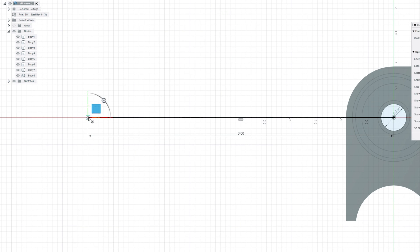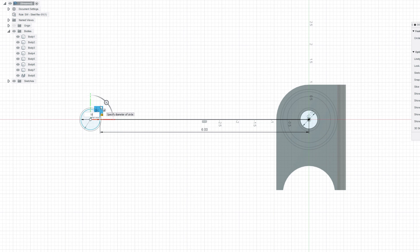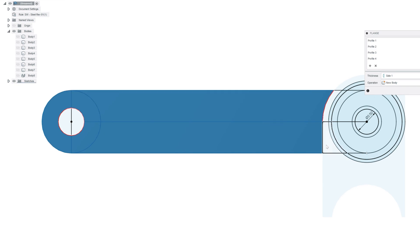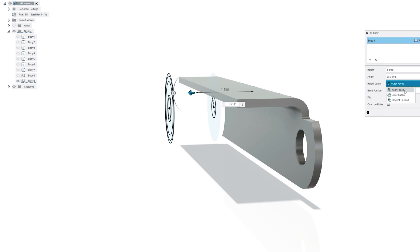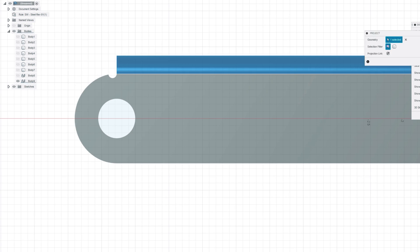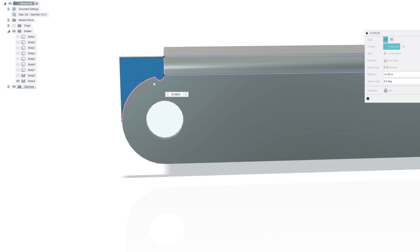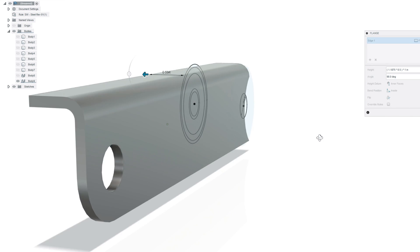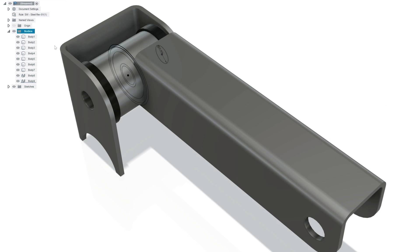As you can see I've gone ahead and drawn up our bushing with accurate measurements — accuracy is really important here because all of this needs to be to scale for this to work. Following the bushing I'm drawing a bushing mount housing using the sheet metal tool, and I'm going to draw the cope on the bottom which is going to be used to attach to our tube. Following that I'm drawing the motor mount arm — dimensions are based off measurements I pulled from the car: 1 and 3/16 inch wide, 6 inches long, with a 14 millimeter hole in the end.